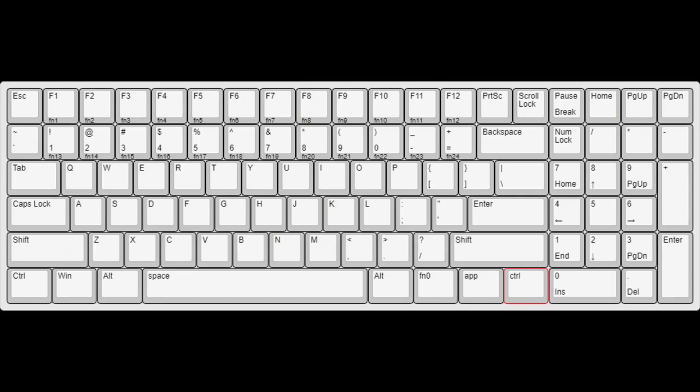The RS-96 supports a variety of layouts. The most keycap friendly one would be the ANSI 60% with a standard numpad, but that sort of defeats the goal of the 96 key layout. One better option is to split the numpad 0 so that it can also act as a navigation cluster, much like on a Vortex Vibe or that one Cooler Master keyboard. A different approach is to embed the arrow keys between the 60% and the numpad by splitting the right shift.